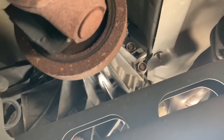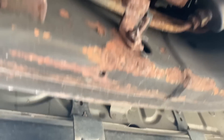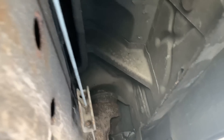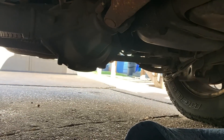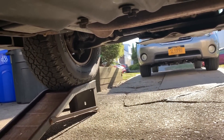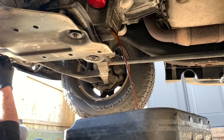New joints — that seems alright, I can't really get to the back joint to check it but it doesn't look too bad. I'm going to go down the back, finish looking underneath, maybe check the diff fluid, and then we'll go change the oil. On the other side of the transmission now — the tail shaft had a little tiny drip, nothing major. I did find the fuel filter; fuel wise doesn't look too bad, I should be able to get to that and pop a new fuel filter in it. Underneath inside the rockers looks absolutely perfect — there are a few cobwebs here and there but body-wise this thing is immaculate. Body bushings look like they're in perfect shape. I checked the U-joints — those are nice and tight. So far everything looks absolutely great. Spare tire is back there, so right now I'm going to go change the oil.